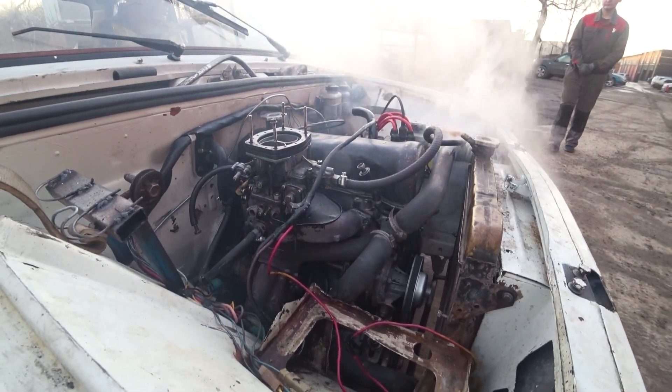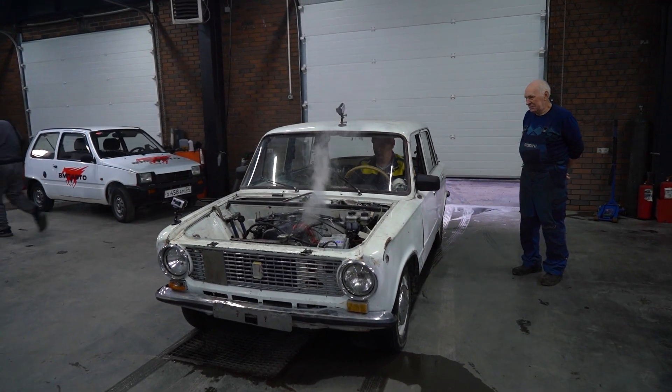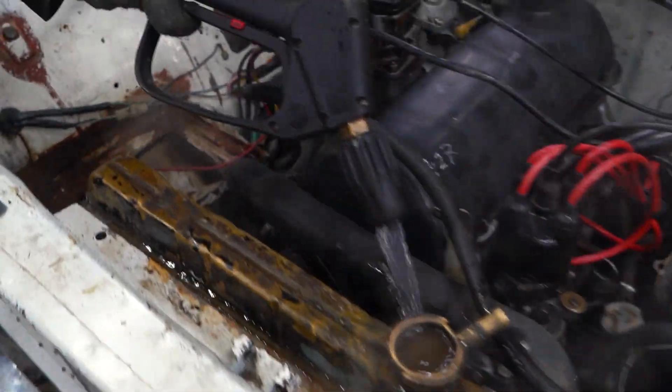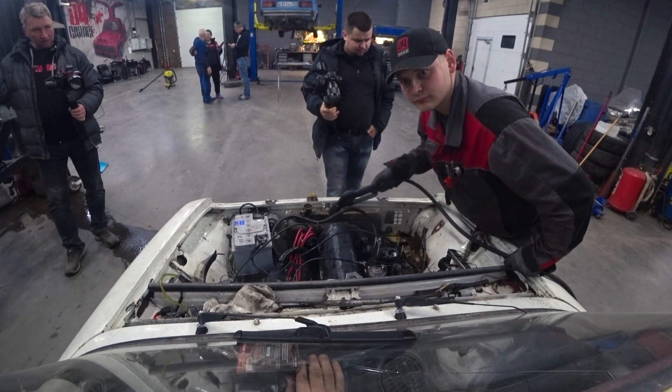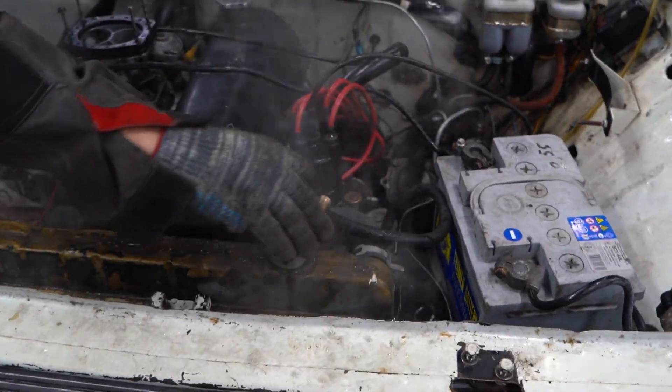Is it missing the cooling fan? Yeah, the fan is missing. We are currently in the process of cooling the engine off — the heater is now up and running, I can feel the warm air, and it's not allowing the engine to overheat. In the meantime, we're pouring cold water straight onto the radiator for some additional cooling, which is fairly common practice. The temperature is normal now, we're looking good, and hopefully the heater can do its job and the engine is not going to overheat.